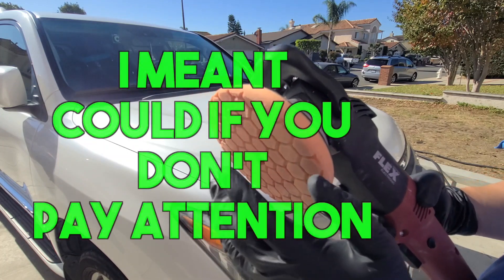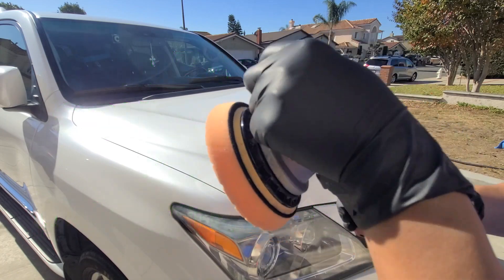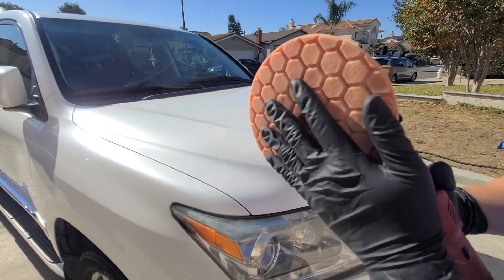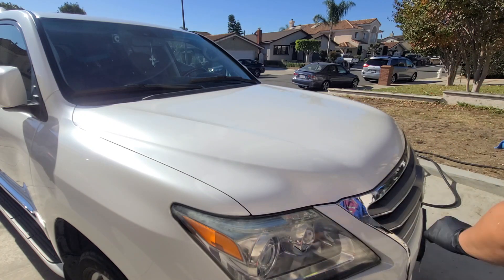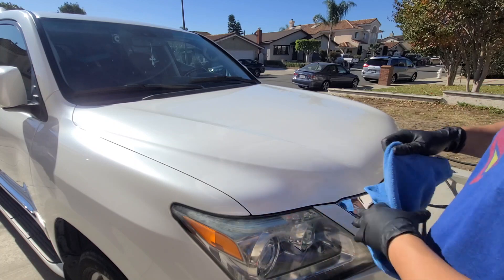I went at high speed but you've got to be careful — you don't want to burn the paint. Usually you can't burn the paint as easily with a dual action polisher. If you've got a rotary you definitely will burn the paint, which is a bad thing. Also it can pull out of your hand, so make sure you've got a tight grip or it's going to swing. If you ever drop the pad on the ground, clean it before you use it again. This isn't going to be perfect because it's been sitting under that PPF for seven years, but we'll see how it does.